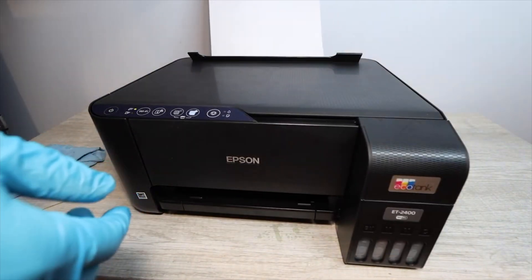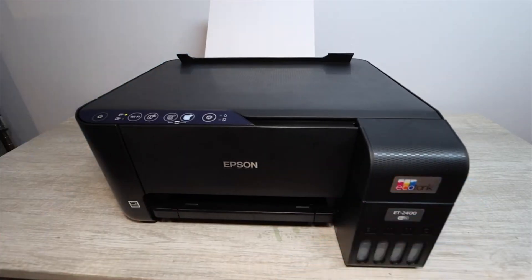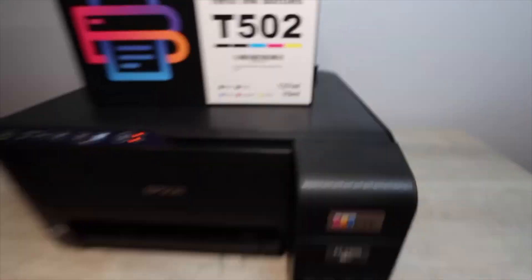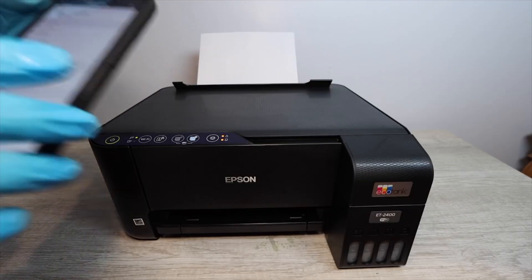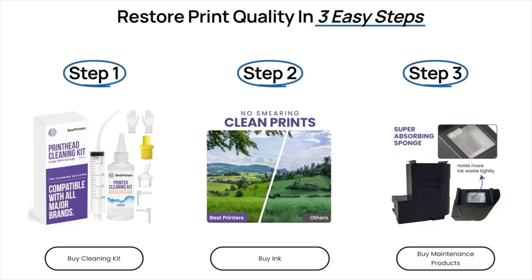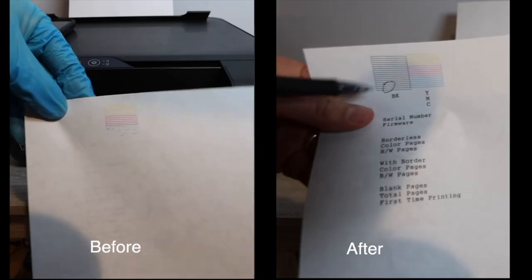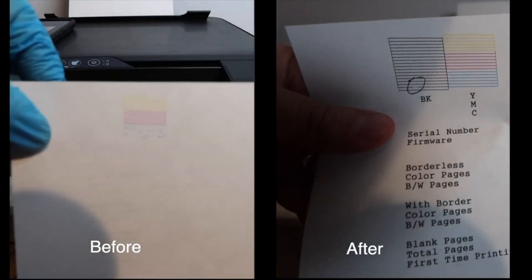Plug in the printer after the 24-hour period, and not before then. At this point make sure to fill up the ink — there will be a link in the description below for remanufactured refill ink for this specific printer. There is a three-step plan: change out your maintenance box as well, with videos in the description showing how. It can seem overwhelming, but as long as you stay on top of this maintenance going forward you will not have this problem again. Use the cleaning kit, then refill with ink, then change out the maintenance box.